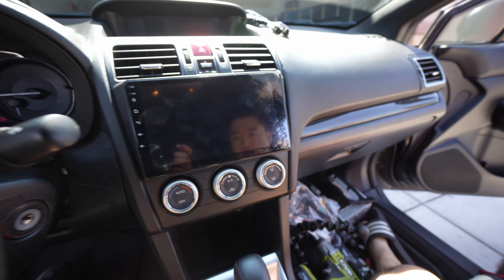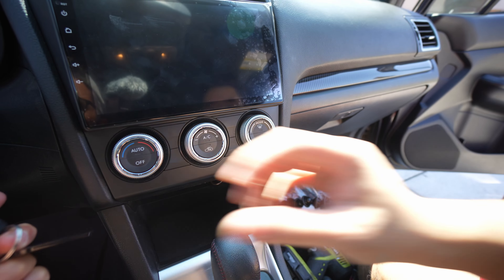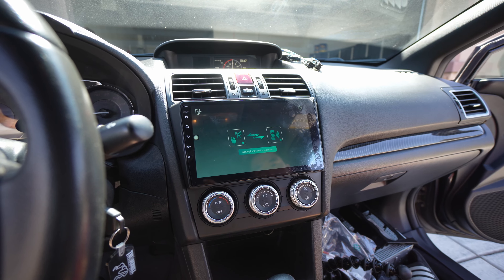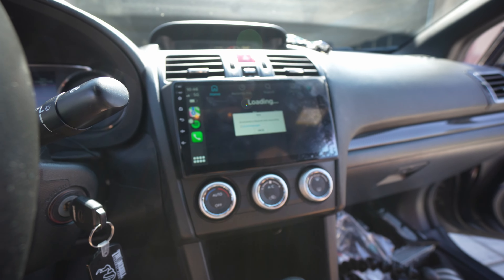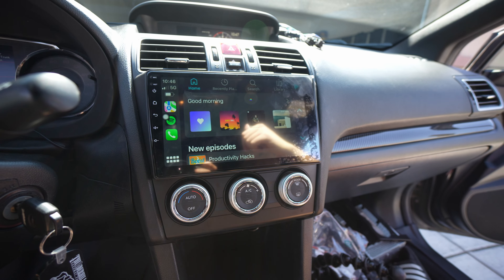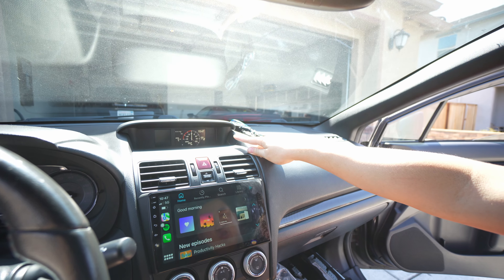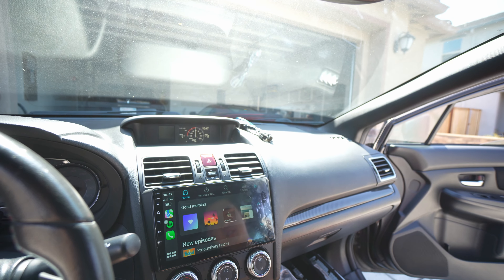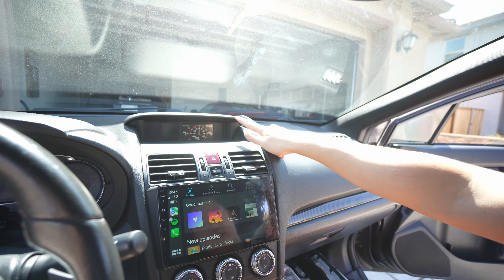Maybe we'll get a quick turn on — if the owner can do the honors. I can't believe it instantly boots like that — we just unplugged it. It's going to look for iPhone connecting — verified. And it'll play music. Now there will be an error right here — I totally forgot about it, for the 2015s only. You have to unplug a fuse, reset it, and then replug the fuse in. I don't remember which fuse it is, so I have to look into it — I'll reference it in the description or comments. There is a fix so it doesn't say 'check audio system.'